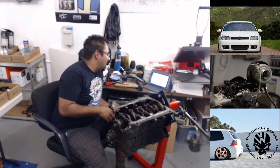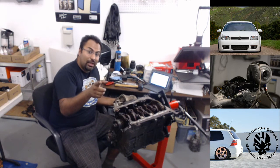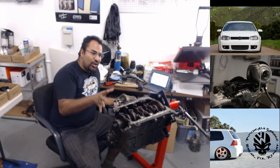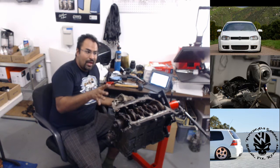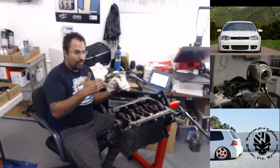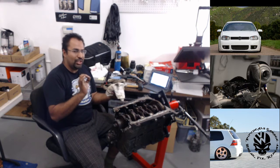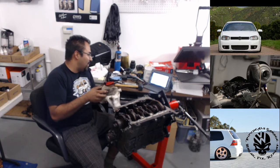Yeah, Eddie, I know the pops and crackle are cool. You know what you do? Put a bigger turbo and a bigger exhaust, so 3-inch all the way out. Put a good muffler. Don't cheap out on your muffler. A big MagnaFlow straight through or what we call an offset. You'll get your pops and your crackle, but it'll actually sound freaking legit. Like, it'll sound gorgeous. I don't know if you ever listened to one, but it's way better.